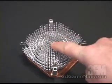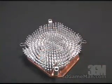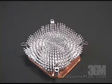Here at the center you can see that the pins come up straight, and around the edges they come up at an angle. The spacing and the angles between the concentric rolls have been precisely calculated to optimize cooling and reduce noise at airflow levels as low as 22 CFMs and 23 decibels.